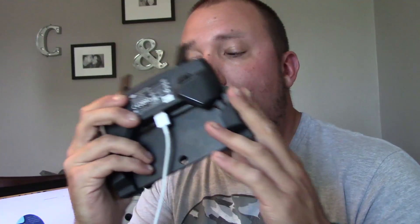Real quick, there are a few general things for new people so we can cover everybody. First, obviously check your USB cord for Android, check your lightning cord — see if it's faulty. Try going from the bottom port of the Mavic into the smart device and see if you still get a disconnect. Try to rule out as many things as you can before proceeding to the next part of the problem.